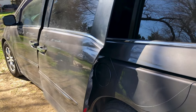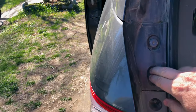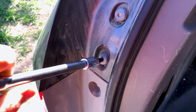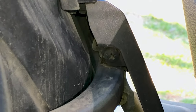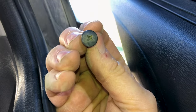Since I was not able to get that door open, what I'm going to try to do is remove this panel. Usually you do this later in the process, but in this case I'm going to try to do it now by removing these two bolts. These are Torx bolts, so you're going to need a T40 Torx bit. I've had to climb inside the car, and before that panel can come off, there is a Phillips head screw right there that we're going to need to take off, and then that panel can be removed.